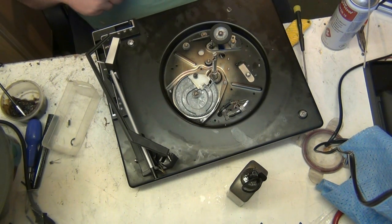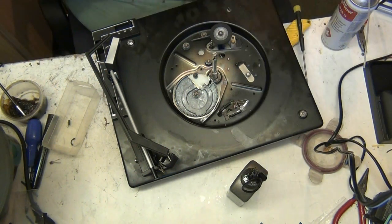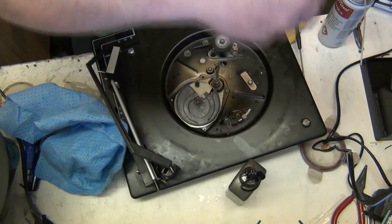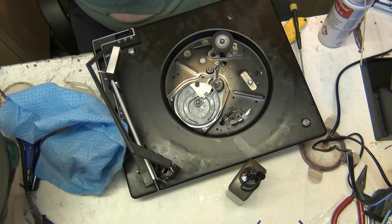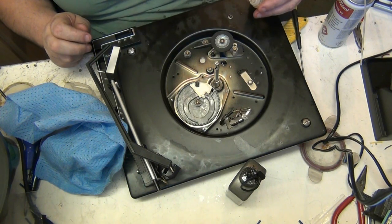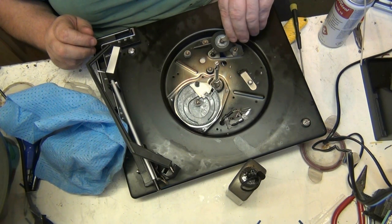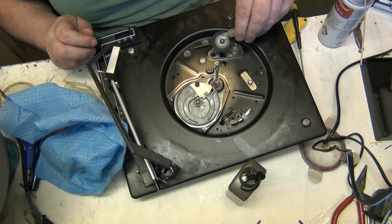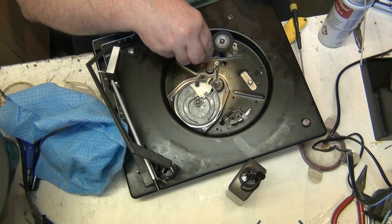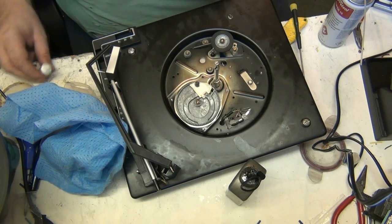It certainly will. So what I'm going to do now, I did have a little oil here, with Garrard written on it. Here it is. Now she really is getting the 5-star treatment. Garrard oil. It came with one of my Garrards. Just drop a bit on there. Double refined, treble refined whale oil, probably. Good oil anyway, and there's not a lot left. Drop a bit down into the bearing. There we go, that'll run down into the top bearing now. Put the top on for a minute.